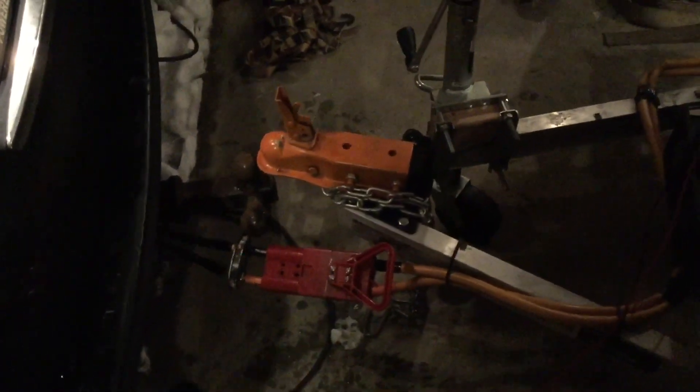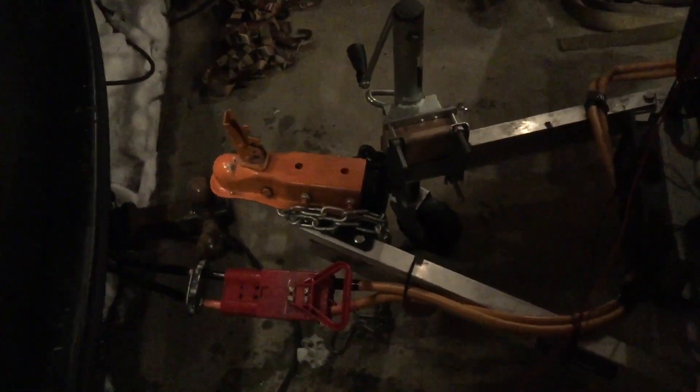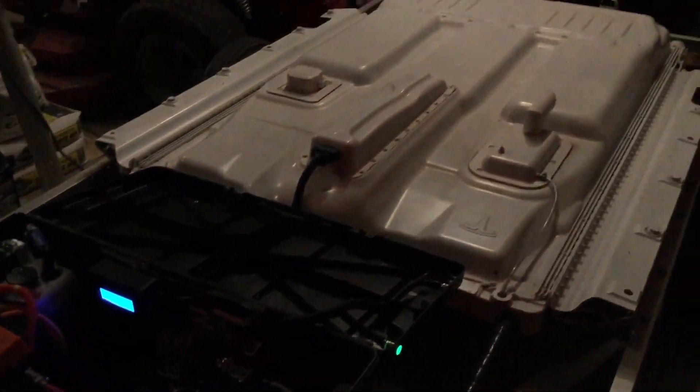As long as you build the cables to handle the amperage. These are two-aught cables. The cables going to the battery in my car are two-gauge, but they're better than most two-gauge — it's a special high-voltage wire designed for electric vehicles. I think these were rated to around 260 amps, which is pretty high for a two-gauge wire, and there are just a ton of strands. If anybody needs this stuff, send me a message and I can definitely send you some info.